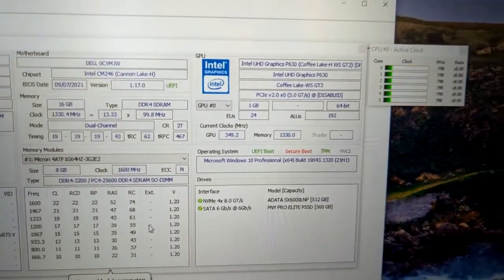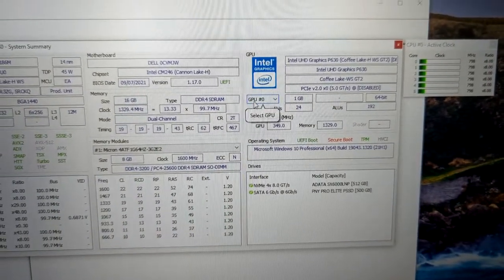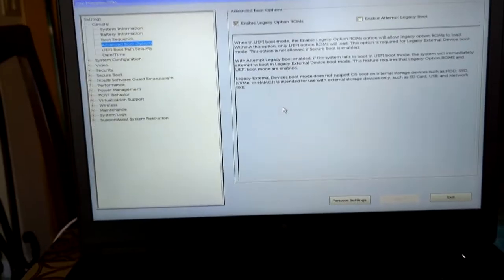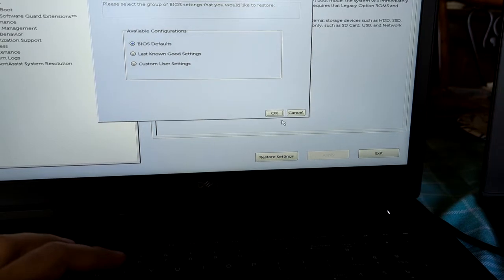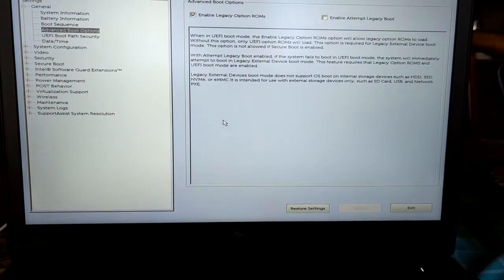The BIOS did not detect the graphics, and neither did Hardware Info after I had Windows 10 installed. So the first thing you've got to do: go to BIOS, reset the default settings. Check there first so that you know you have the graphics card detected.